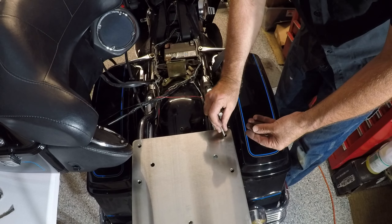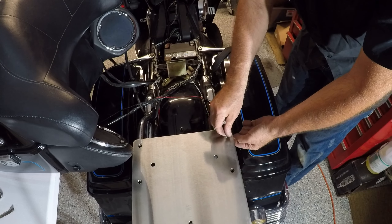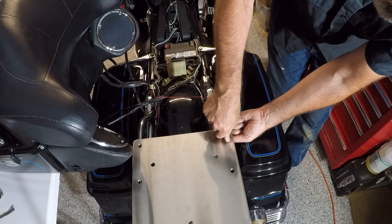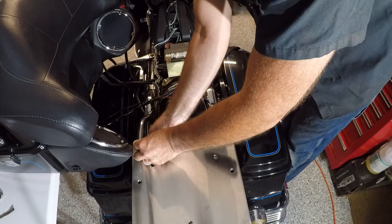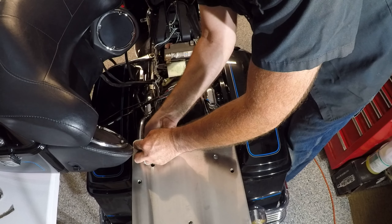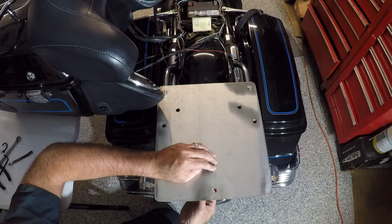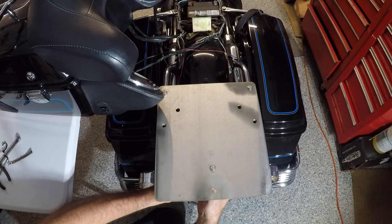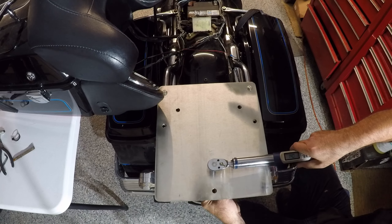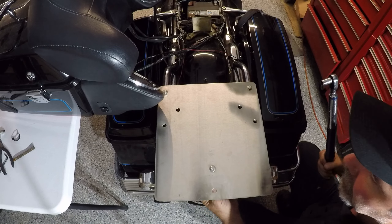The five holes need to line up. I'm supposed to install two bolts in the front but do not tighten them — two inch and three quarter bolts. So I'm just installing the bolt, washer, and a nut. Let's put this inch and three quarters bolt through here. Seven sixteenths. I'm working this to 14 foot pounds — yeah, that's 14 foot pounds.